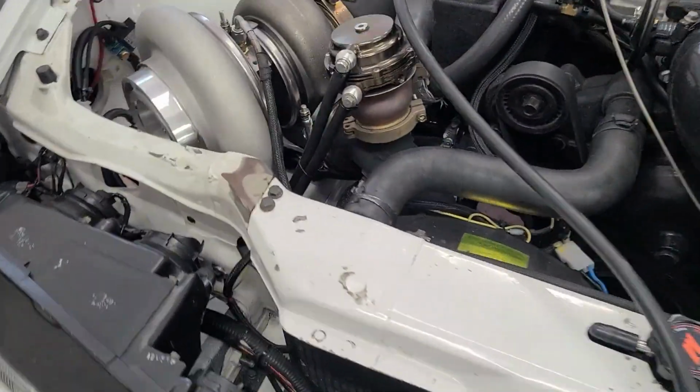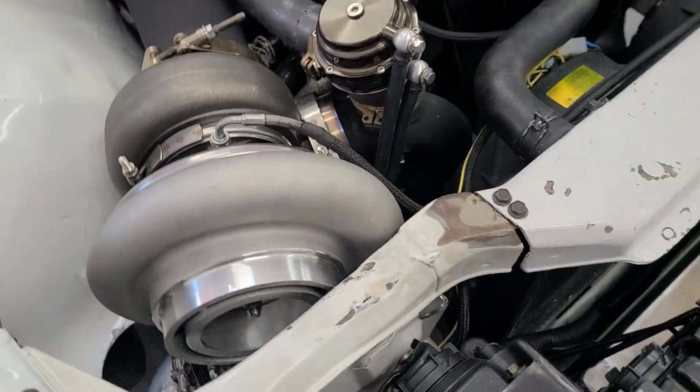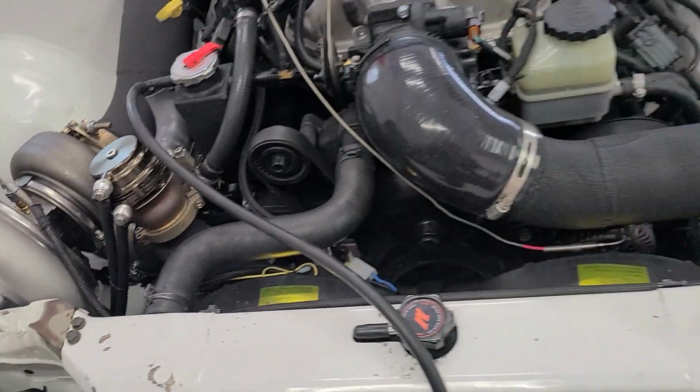So where I'm at here is basically take number 3 on the oil line. This last thing I just did was I took the actual whole oil line off the car completely just so I could visually inspect it and see if there's any problems. It had a bunch of grit and dirt in the fitting from whenever I was grinding and cutting on the engine bay. A bunch of that crap got down in the exposed oil line that was just sitting there. And I knew it did that before, and I totally forgot about it. So there was definitely a bunch of grit up in that fitting.